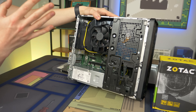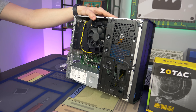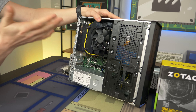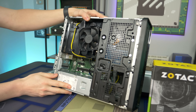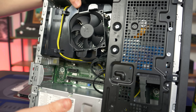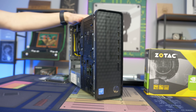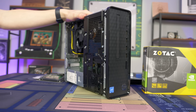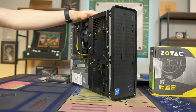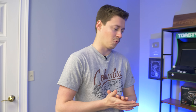The other thing this PC really lacks is RAM — it only comes with a single 4 gig stick, so that's another thing we're upgrading. It's going to be a weird number, 12 gigs, but it'll at least be running in dual channel, which is what we're going for. It does come with Wi-Fi, USB 3, and a lot of really nice ports in the front. The main takeaway is that for $600 you're really not getting the best bang for buck, but right now's market it's not terrible.